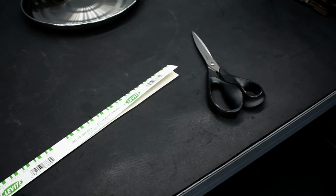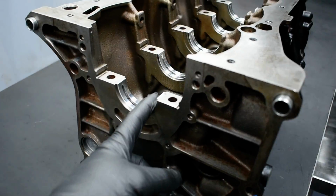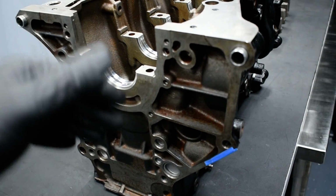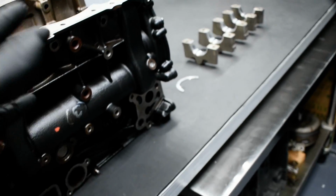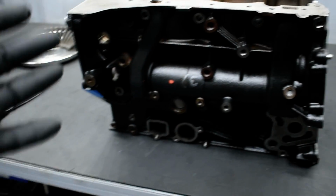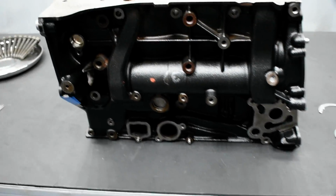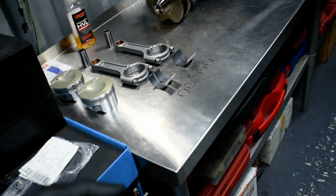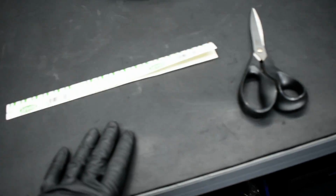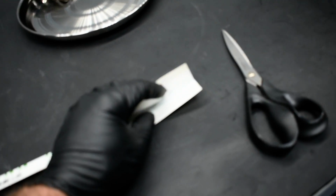Yeah, I know what I said, but what's going on now here? If I put the crankshaft, I have to put some oil on the bearings. If I put oil on the bearings, after that I have to wash the bearings, clean it, and then put it again and check for the clearance with the plastic gauge. I get first a measurement, but I want to double check also the plastic gauge. So what I'm gonna do now, I'm gonna check for the clearance with the plastic gauge, with the dry bearings obviously. Then I'm gonna remove it, I'm gonna see the clearance, I'm gonna put some oil, and I'm gonna insert it again inside, because if I put the connecting rods in, I have to rotate the crankshaft to bring a top dead center. And like I said, I don't want to do that without oil. So let's check the clearance and then the rest.